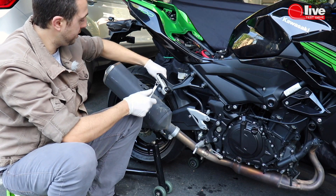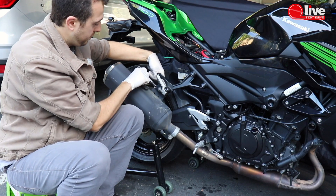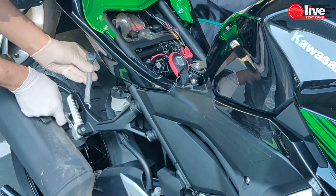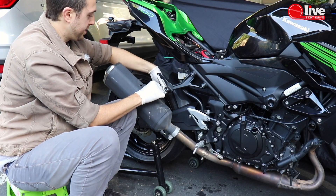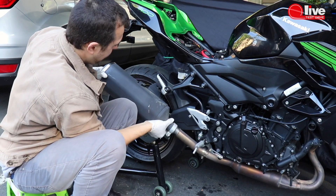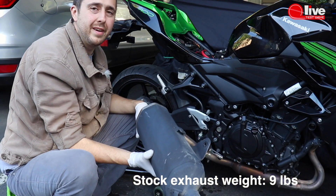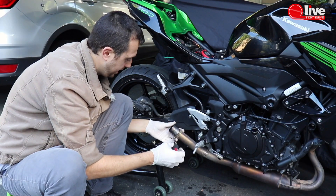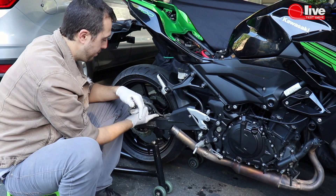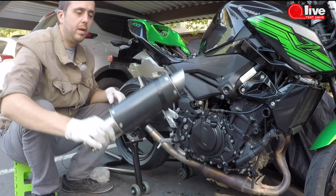Before you go further, I'd suggest you take this bolt loose, because the exhaust will wiggle a lot once you remove the bottom clamp. The back bolt is 12mm, the front is 10mm. Removing the rear screw — I lost it, and found it. Slide it out — that's probably eight to ten pounds right there. You just dropped a lot of weight. Now remove the old clamp; you don't need it anymore. This is a good time to clean up brake lines, frame, anything that was closed off by this giant heavy exhaust.